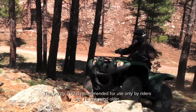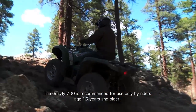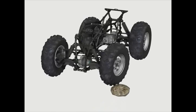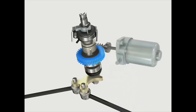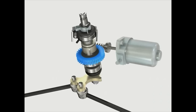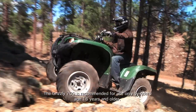The EPS system also really excels when riding in very rough terrain, where ruts and rocks have the tendency to quickly force the wheels to one side or the other. These jerking wheel movements are transferred back through the steering system to the EPS unit, which activates the electric motor to quickly counteract the force and buffer movement of the handlebars. This results in a more comfortable ride in all types of terrain.